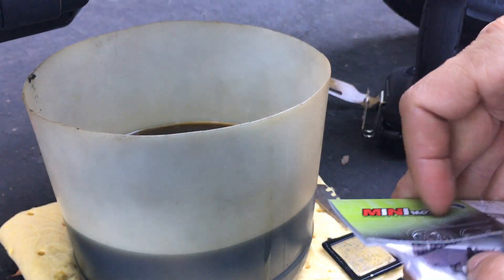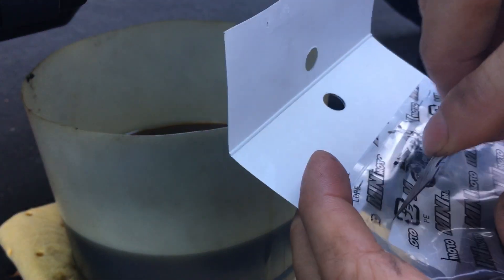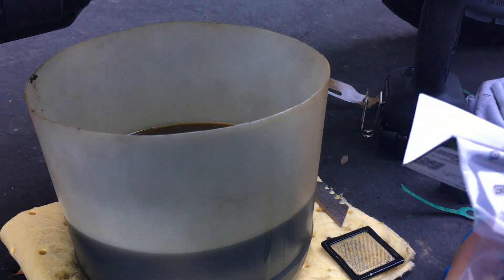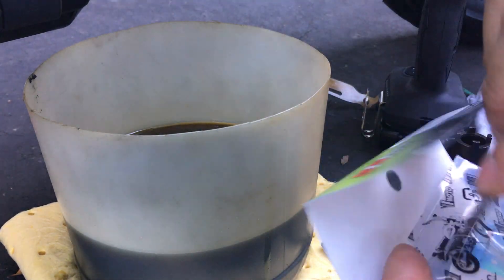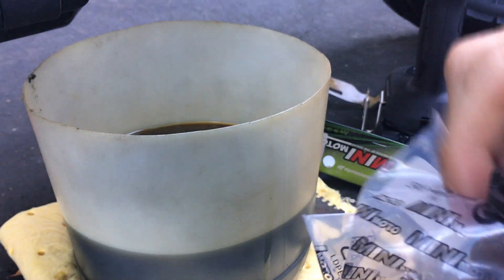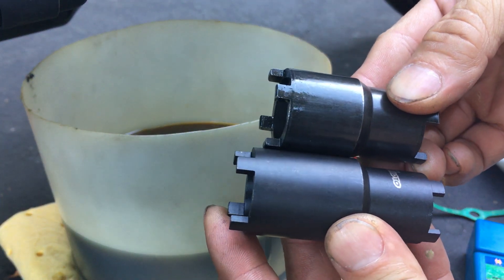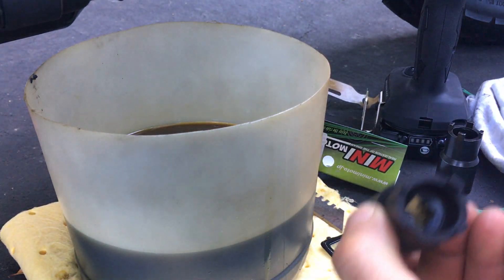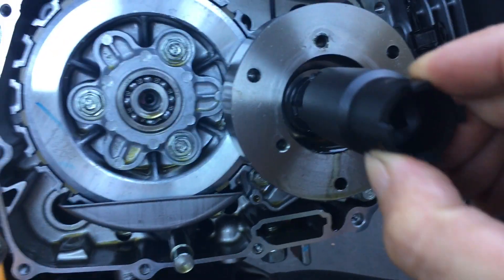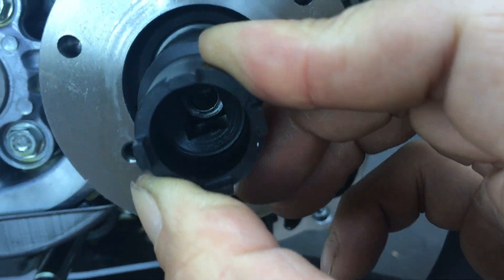Obviously it's still brand new, so I haven't even taken it off to double check, but just looking from the outside I can tell it will fit. So you can see here it's a lot deeper than the previous one — that's what's going to give me my reach. And looking at this drive, it's actually a three-eighths drive, not a half-inch. So it wouldn't clear the spindle if it wasn't deep enough, but now it's all the way in and you can actually see how the spindle clears that three-eighths drive.